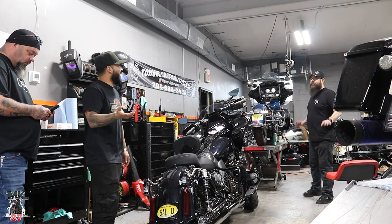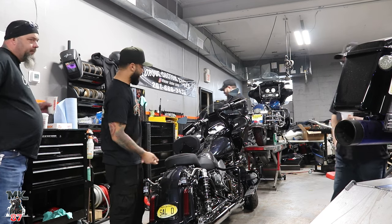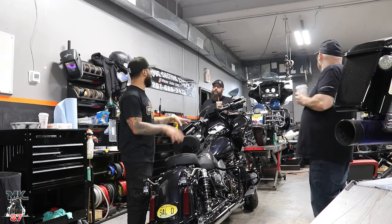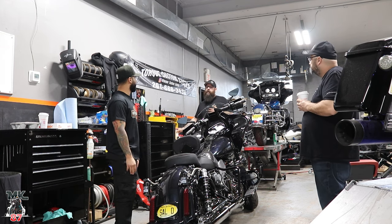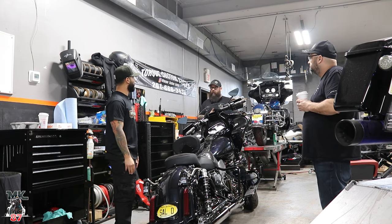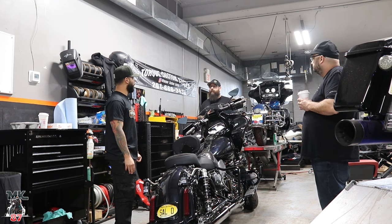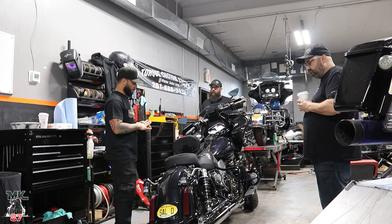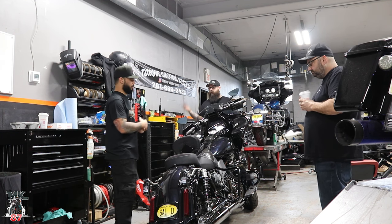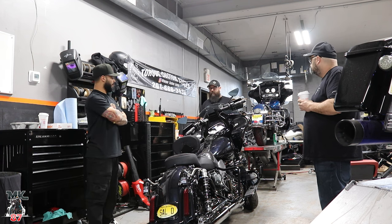I'm not going to hear my bike next to this bike anymore. What's the plan now? We've got to heat cycle it a few more times and continue to set the engine into place, then go through the break-in process which is a few hundred miles of easy riding. But otherwise it's done — it's ready to roll. After the break-in period we can put it up on the dyno, give it a full tune, and it'll be 100% set.